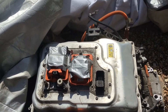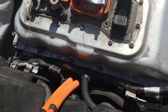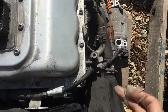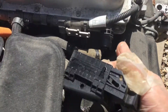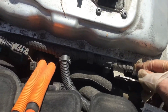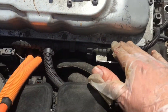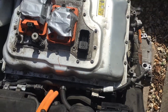Now we can see a bit better about getting the inverter off. There's a coolant pipe there, an earth lead there, a bolt here, and a bolt here. There's a coolant attachment there. I think these are just clipped in along here, so I'm going to unclip these clips here, and then do those pipes, that earth lead, take those bolts out and see if it'll lift.